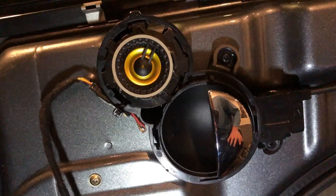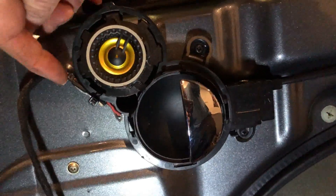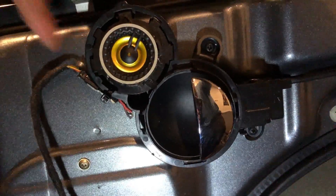Just align that. Underneath the door now — I'm going to remove that 10mm socket. Remove that window stay back. I need that room to get the lock actuator out.